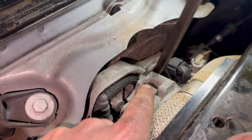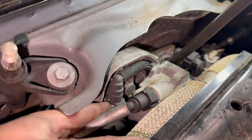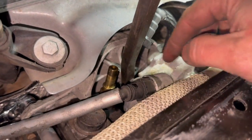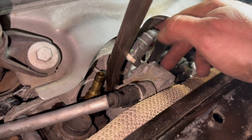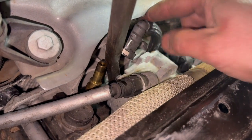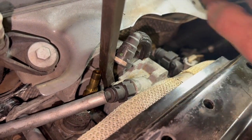With the bolt undone, you can lever the cover - it won't go upwards, it'll only slide backwards. Levering it back leaves just enough room to get the pipe out, then feed the other bit of pipe through. Levering it back you've left enough room, and it wasn't too bad - you just had to sort of lever it while doing it to pop the pipe out. You then need to pry it apart to get the actual pipe through, but that's the trickiest part of the job.